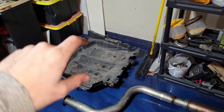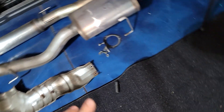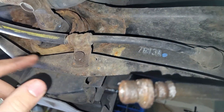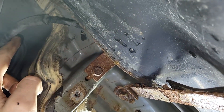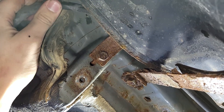This has got to be some sort of Christmas miracle — we got the exhaust dropped, the heat shield removed, the plastic tray removed, and none of the hardware even fought me at all. All the bolts came out pretty easy even though they're pretty rusty and crusty looking. A couple of the plastic trim pieces stripped out a little bit, but that's expected. Going under the car now, we have a much better view. Here's where it comes to the trailing arm and we'll be removing this bolt. We have much easier access to the next bolt, and the e-brake cable snakes around into the cab of the car right underneath where the e-brake handle is. This is going to be pretty easy to remove — we'll do both sides.